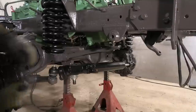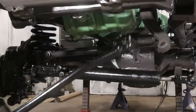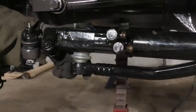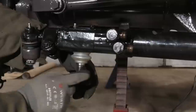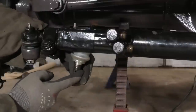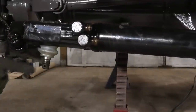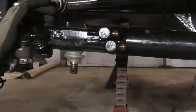The cylinder just mounts into the fixed point over here and into the swing arm on the swivel over here. Then the link from the pitman arm on the steering gear, instead of running to the swing arm, it runs to this joint in here. Now this is actually not a ball joint - it does have some give in it, but that's because this is actually the valve that opens and closes the hydraulic pressure in that cylinder. So when you turn to the right for instance, it's going to be pushing over this valve letting pressure into the cylinder, and because the other end is fixed in place, the whole thing is just going to be pushing out moving the swivel with it. Same of course if you turn the other way, it puts pressure in the other chamber causing it to retract and pull the entire thing in again.